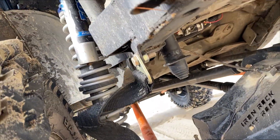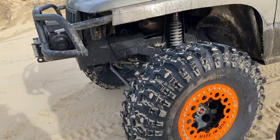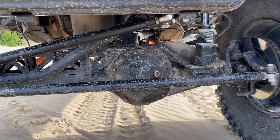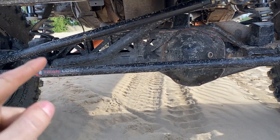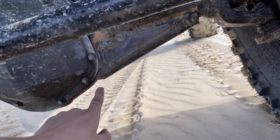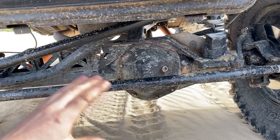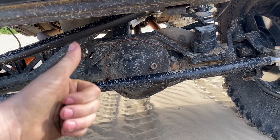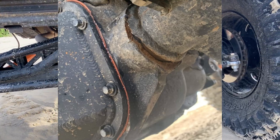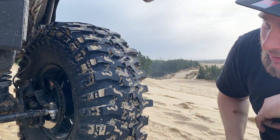All limit strapped and bumped, set up properly. Let's go to the front. This is the same axle I had in the front of mine before I did the one-tons — same truss and everything. We've had three of them now break down here at the axle tube. You can see how much gusseting he has all over — he has just beefed the hell out of this axle to survive the beating. Maybe I'll throw up a picture of what it looked like earlier this week because it was in rough shape. Got the welder out and got her looking good here at camp — that's why it's unpainted. What lockers? Grizzly locker, 5.13s to match, chrome moly shafts.